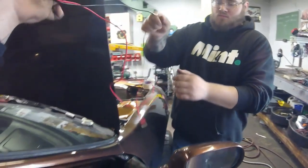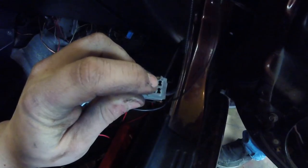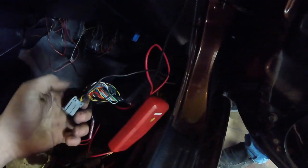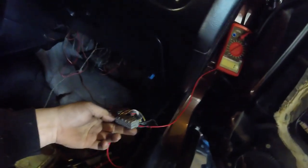We also got some bare green and yellow wires down here that we don't know where they go. Pretty much what we're doing is we got a multimeter on the inside of the car. I give one end of the wire to Christian and then I take a wire and I'm pinning the ECU plugs. This is connector A right here, the biggest plug of the ECU plugs. When you're looking at it this way, the top right is injector one, bottom is injector four. There are diagrams online for this stuff if you want to go look it up. We're literally tracing wires on a diagram to see exactly where each wire is going on the harness to verify it.